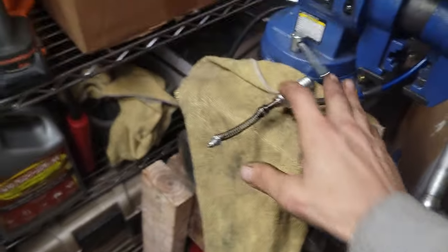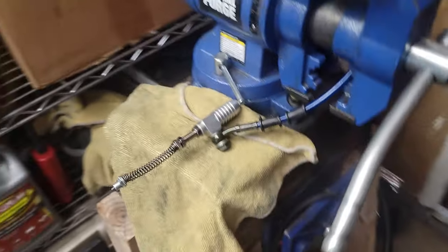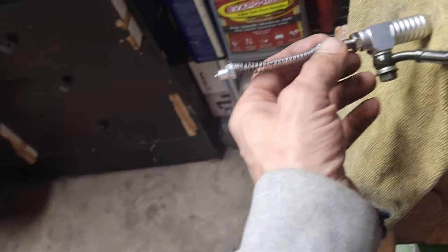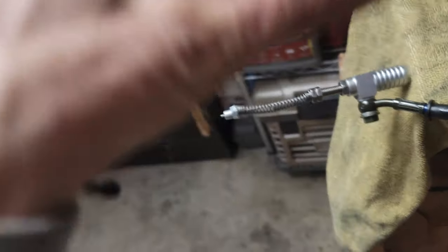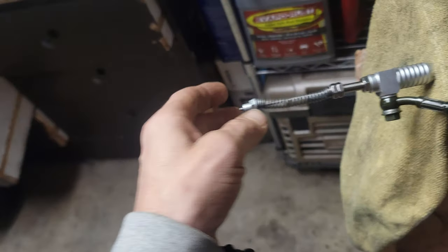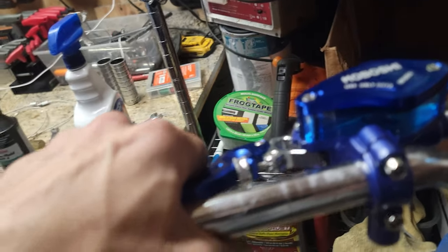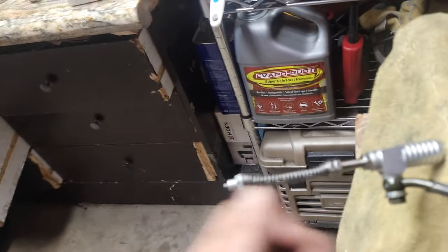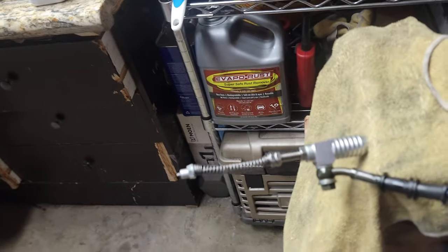That's a tip on the hydraulic clutch. Because I looked on YouTube and there's literally nothing on these hydraulic clutches. I've seen a couple of foreign posts where people said they had a hard time bleeding them. Honestly, I didn't have to do nothing — crack no fittings. I did crack this once or twice, pumped it, cracked it, and then tightened it. But once fluid came out and everything was kind of full and the bubbles kind of stopped coming out by squeezing it, then pumping that system back and forth — pumping the piston back and forth — pushing the bubbles up basically works great.